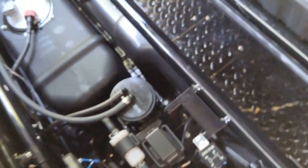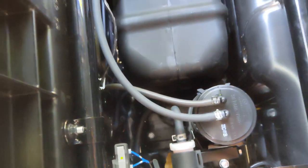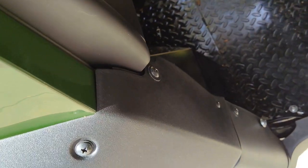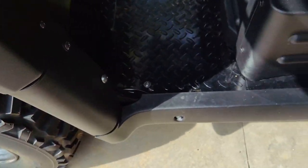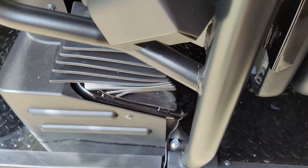This is a view of the inside of the cab looking down at the accelerator pedal and where all the wiring comes through the center. You can see the bundles that travel through there, and there are actually screws that you can take apart and lift that whole section out to get to the wiring. I originally tried to run my wiring through there just with a fish tape because I didn't want to take everything apart on a brand new machine. When I couldn't fish any wiring through, I just went ahead and ran it through the front as I explained earlier, and it worked out just fine.